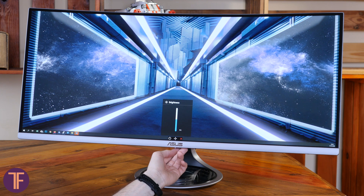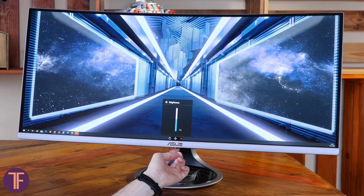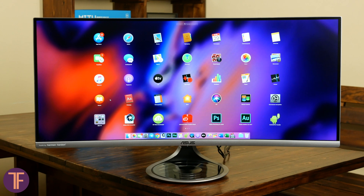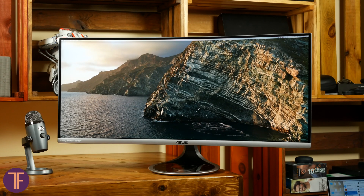Nevertheless, the maximum brightness makes the screen perfectly readable, at least in our office during the day, and its minimum doesn't hurt your eyes at night. PWM is not used here to adjust the backlight intensity. There are no fierce traces, kind of like motion blur, even if you are not using overdrive — the image always looks clear enough. If you enjoy playing games, you'll be glad about the refresh rate range from 48 to 100Hz and the FreeSync option. The display is half-matte, which prevents disturbing flares or hot spots, and Asus uses special technologies to lower the shimmering.